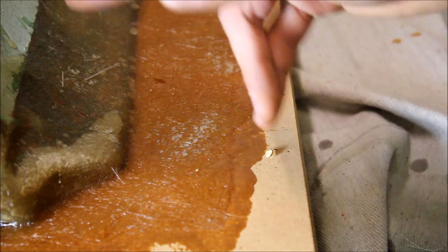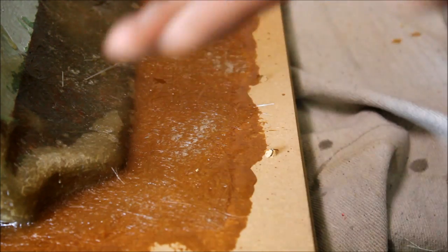This is the bottom piece. What I do to help make it a little bit stronger and ensure I have 100% seal is we glass over the fiberglass that meets the original piece of MDF that we used for the trim to base everything off of. What this does is it gives us more surface area for it to actually connect to each other, so we have more structure, and if there's the slightest chance that for some reason there's a hole on the other side, which we've already double checked there isn't, we're ensuring that there's a complete seal all the way around.